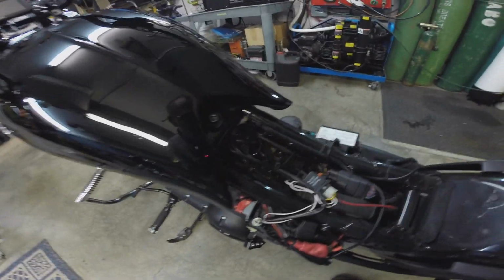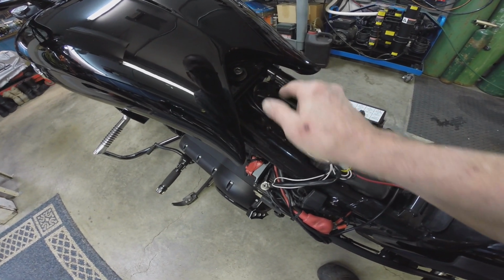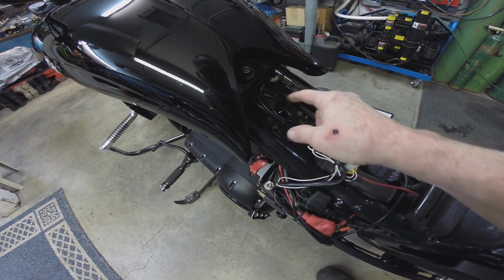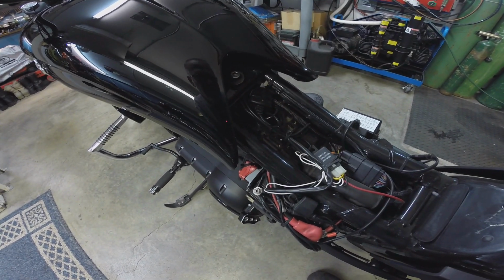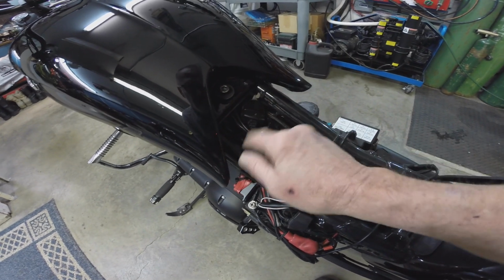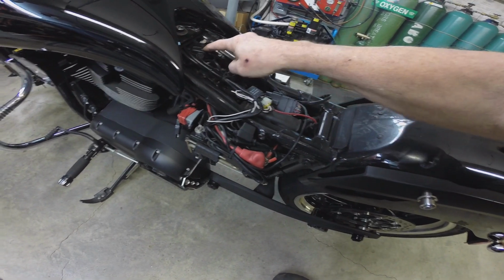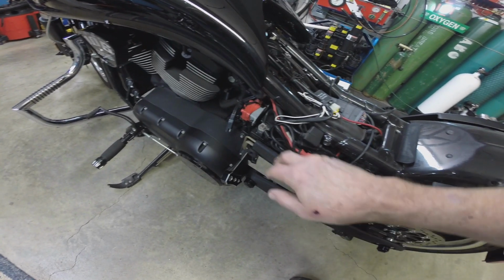I'm not entirely sure why I carry that around, but I guess it does keep it with the bike. This is the power module for the GPS, which I manufactured out of the cigarette lighter plug. I used some silicone sealant, and I cut the cigarette lighter plug part off because there's a little board in here that talks to the GPS and tells it, it gets its battery status and need for charge and all that kind of thing off this little board, and how much voltage to deliver it and so on and so forth. So this is Garmin's deal, and this battery is totally shot, totally dead, so it's not lit up. And the problem is that thing does create a parasitic draw, so you kind of want to keep the battery on, or the GPS unplugged, and just plug it in every now and again.